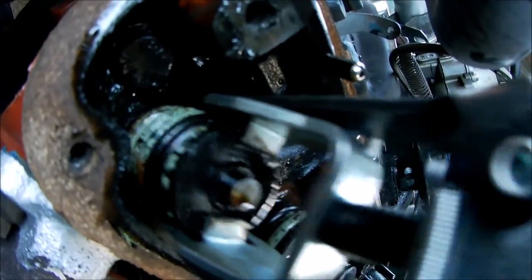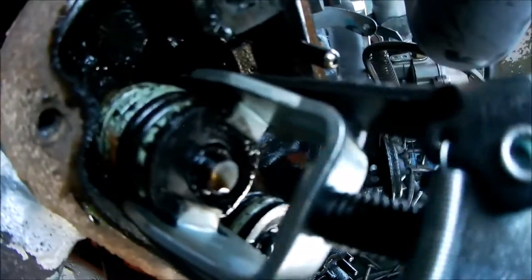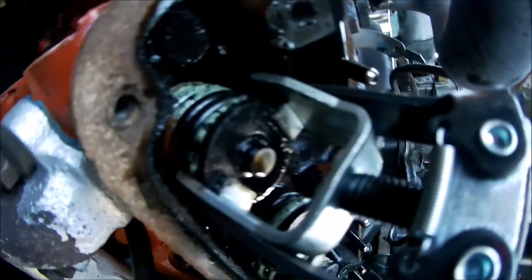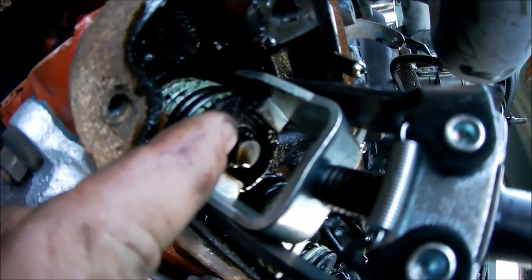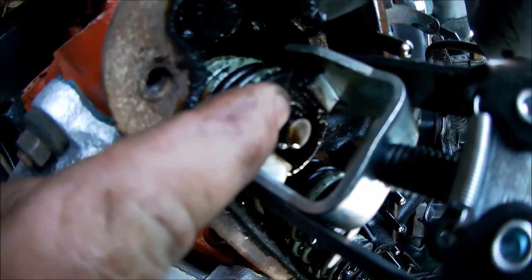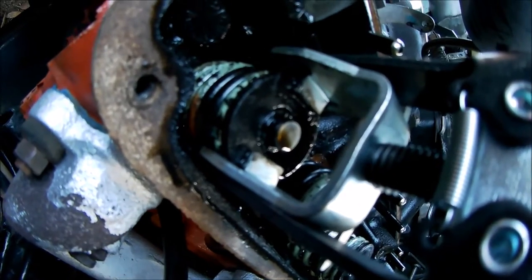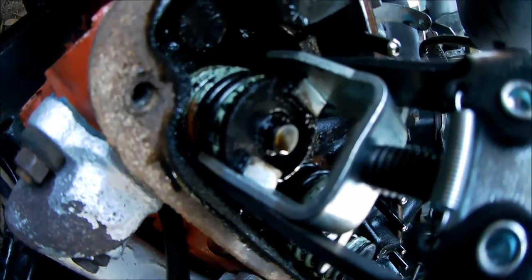You can see that if it's focusing. All right, there's no air in that cylinder at the moment because I had to turn the compressor off to demonstrate this. But down here, there's little collets which have to come out, and they're little. You can drop them, you can lose them easily. So the best way to do that is with a magnet. I normally use a magnetized screwdriver.